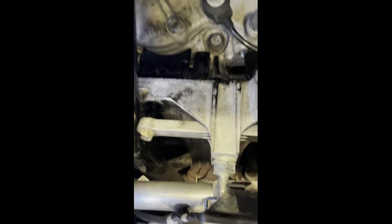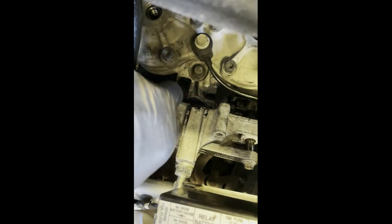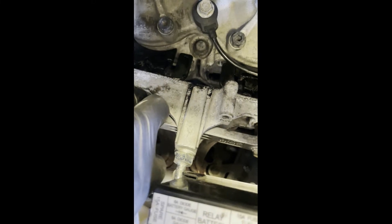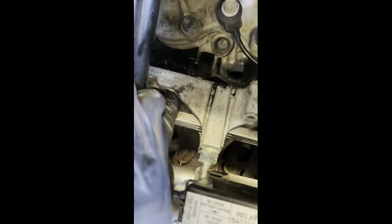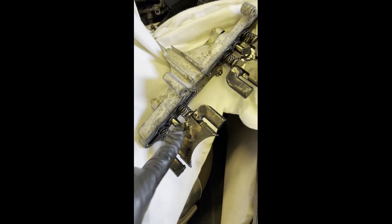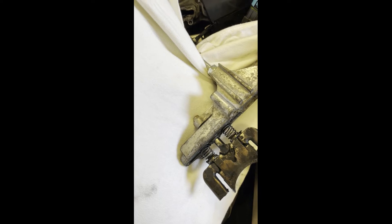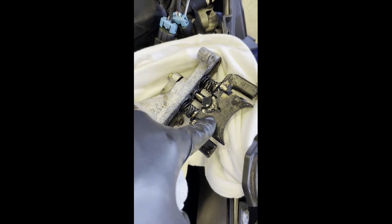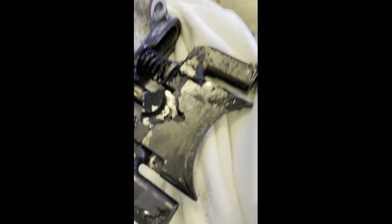The last trick: you can see there's a gap here. You actually push this bar — the one that controls the valves — backwards, so it compresses and creates that gap. Once you do that, you get enough clearance to get it out. If you don't pull this back and it's flush, you won't have enough clearance to get it out. Once you rotate these up and around, this is now the PTO side that lives on the brake side because it's been rotated up, out, and flopped down — and the brake side is now on the PTO side.